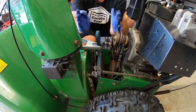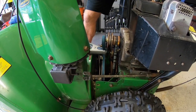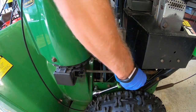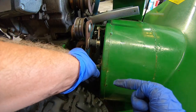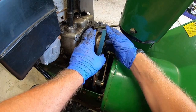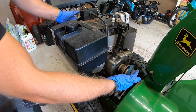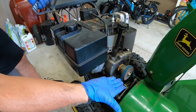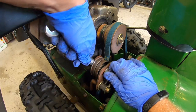Now what I'm gonna do is slide both ends of the machine back together and install one bolt so that way this thing doesn't come apart. Bring it back together, install one bolt and ratchet it down. I'm just gonna install one more bolt here on this side just so we don't stress out the other one. Now we can unclamp our belt, feed it over the pulley - and as you can see it is a snug fit here, it's barely going into this channel where it needs to be. If you pull on your starter recoil - watch your fingers - and give it a turn, that belt should go with it just like that. From here I'm gonna set my belt tensioner to about 1/3 - this is where I start to feel a little resistance on the belt. Hold it in place and snug it down.